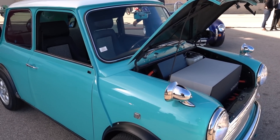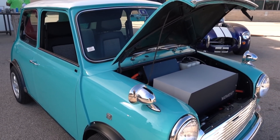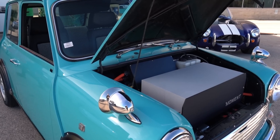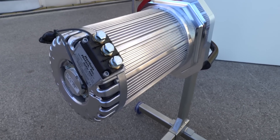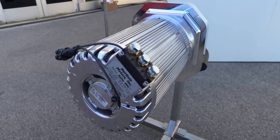If you have a Mini or a Bug or even a Karmann Ghia or something that size — smaller, usually import cars — this is a great option. What we've done is we've built a set of transmission adapters and motor mount rails that allow us to take that same motor and put it in another car with just swapping out a few components.